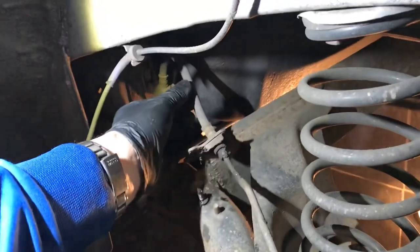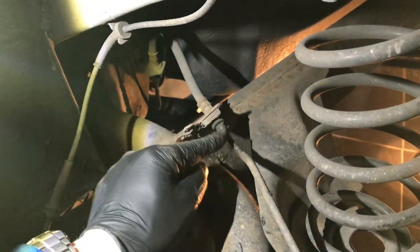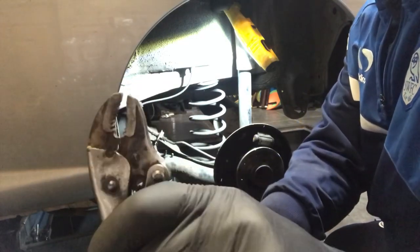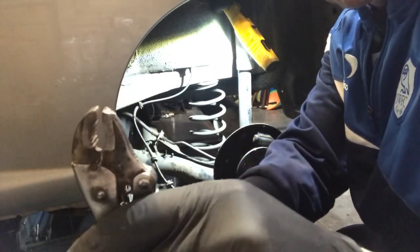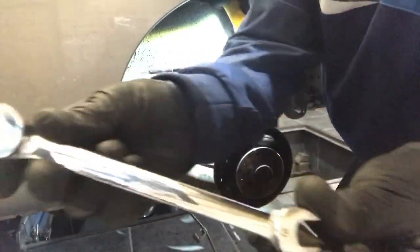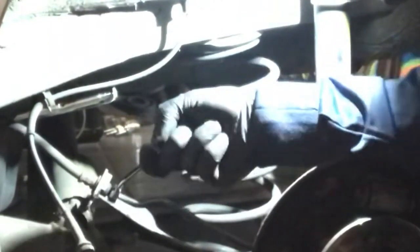The brake part I'll take out with the whole axle and swap it over in a minute. Next I'm going to clamp this flexible brake hose and undo from here, then remove the hose from the axle. When clamping brake hoses without a hose tool, get your mole grips but don't do them all the way up — give yourself a gap so you're not crushing the hose completely. Bang the end onto the hose and now we can undo this knowing we won't lose all the brake fluid. Ten millimetre brake hose spanner — there it goes.